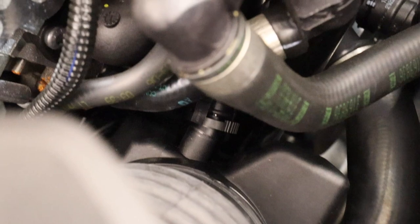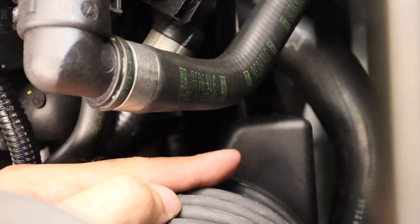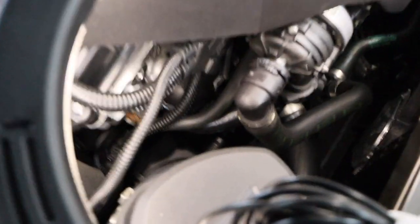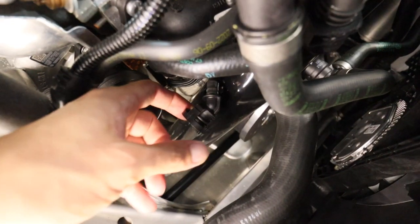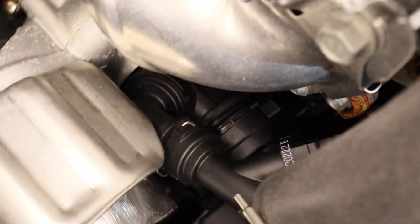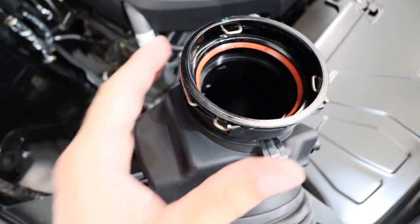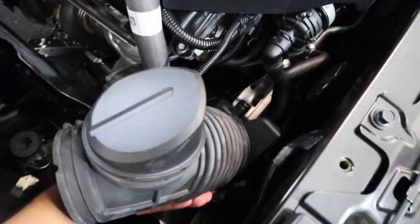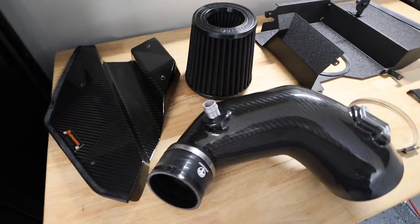With the airbox out, go down the inlet pipe and you'll see the crankcase breather — it's a little plastic fitting. Pinch the corrugated edges on both sides and you'll be able to pop it off the fitting. It takes a little effort; use your middle fingers on opposite sides to pinch and pop it off — be careful not to break it. Next is the metal clamp at the bottom of the turbo. Use a flat head to pull that right off the tube, then wiggle the whole pipe off and remove it.